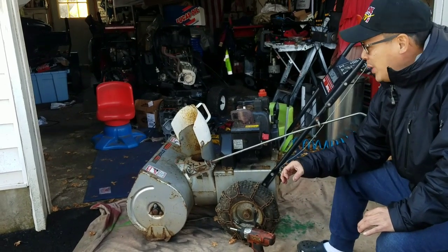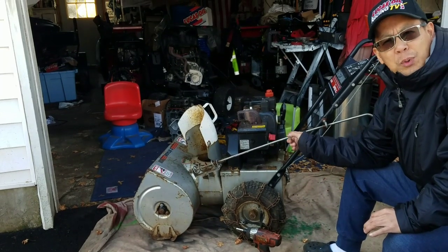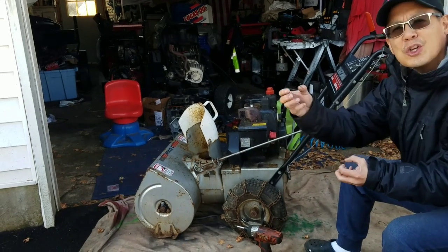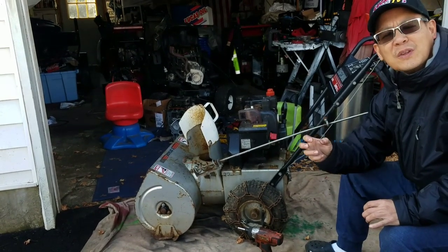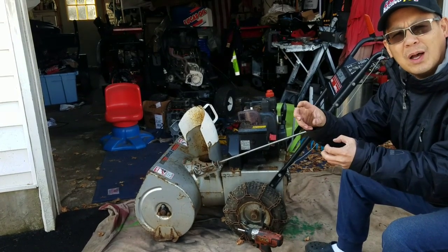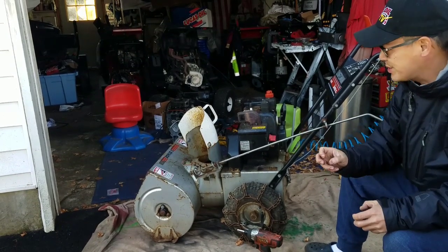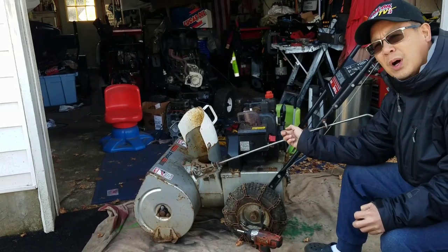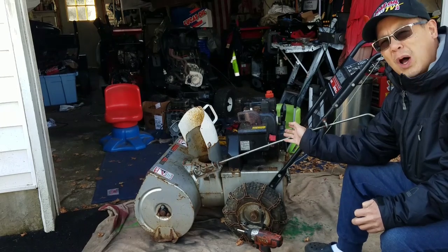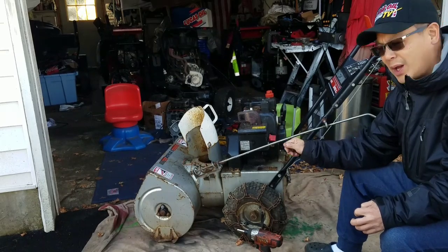But as you also know from my previous episode on this particular snowblower, the electric start was seized up. The shaft was all rusted up. So we took off the starter, and we oiled it a lot, lubed it a lot with penetrating oil, as well as some spray grease from my friends over at Lucas Oil Products. So today I'm going to take this off and clean the carburetor, if you will, since it runs, even though it only runs on choke and in the middle sometimes, right?